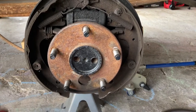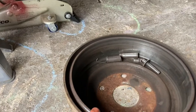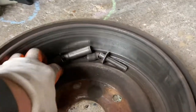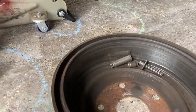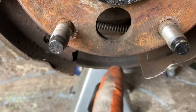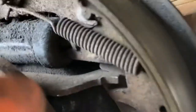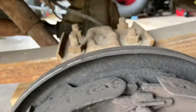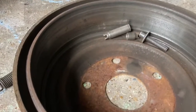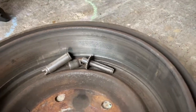I'm working here on the rear left. I went ahead and broke the hub loose — and this might explain a lot of things. There's a broken spring and all those parts just sitting right here; they all came off with the hub. You can look at the wear on these pads — I guarantee these are original. Looking at the inside, when they're turned they still look pretty good.